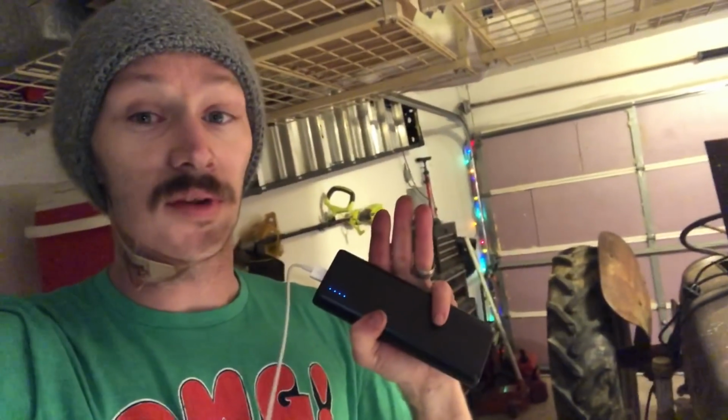But I got the 12-volt battery in, I got the 12-volt coil in, I got the distributor rebuilt and reinstalled, and I got it almost hooked up. But there's a few other things that we need to hook up: an ignition switch, then run a line to the coil, and then see if we can shock ourselves.